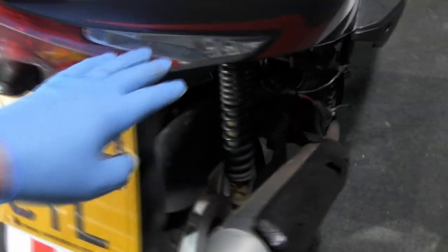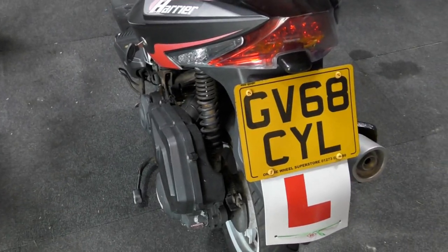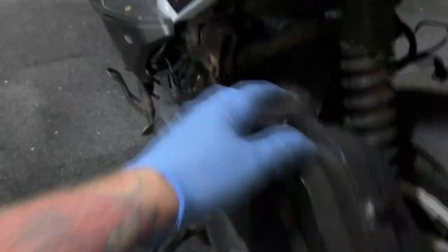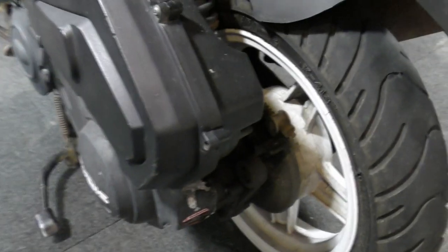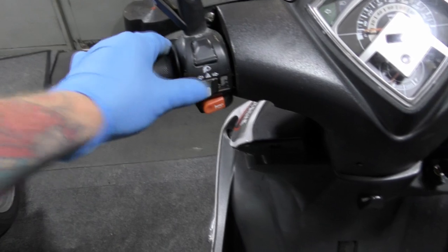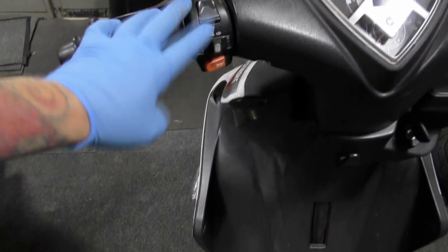That's what I was mentioning about LED lights — these are LED complete lights back and front, except the main bulb. When these go, it's gone — you've got to buy a whole new unit. The starter is brand new. The tyre was flat. The back was spinning like mad — I'll get to that in a minute. The throttle is tacky — it should always spring back. I don't know if it's WD-40 or just poor springs, but that will fail the MOT. It's not retracting properly, though you might be able to WD that up.